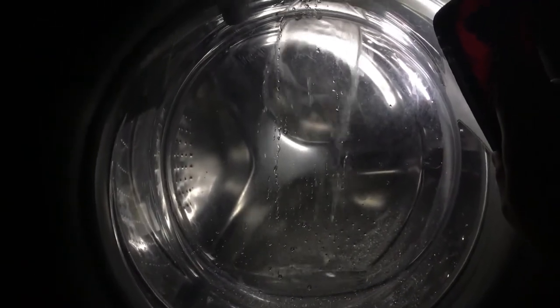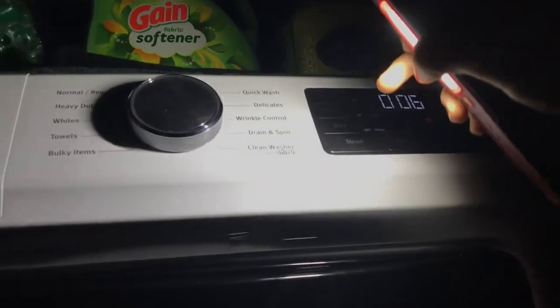Alright, so number 5 is recirculator pump test, and here's what you have. The recirculator pump helps to pour the clothes down wet, and it doesn't actually fill more water in it. It actually sucks the water from the recirculator and then pours the left water down the tub. So make sure not to waste water on this machine. Alright, so that was the recirculator. Number 6 is pause. That means it sits here during a pause. And number 7 is the drain.